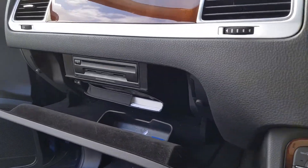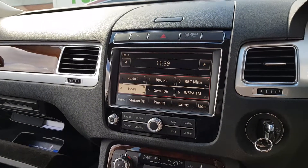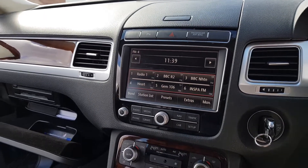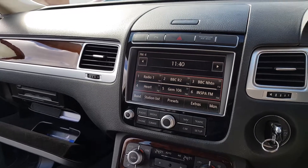Like I say, VW said it was that unit in the glove box that was faulty, but it's not — obviously it's all up and running. There was a blown fuse to the amp and the amp has got a dead short on it. So we're going to take the amp apart and have a look in there and see if we can repair that. Anyway, thanks for watching. Bye!